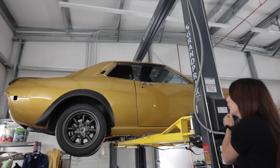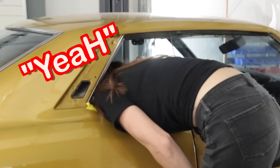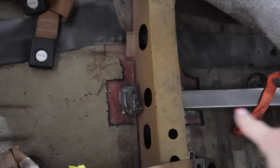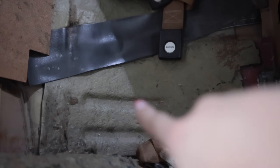Inside the car there will be a bigger plate that those four holes line up with, and it all bolts together and sandwiches the unibody portion of the car to keep those links from pulling through when the axle torques. The real question is what do I have to drill through on the inside of the car? Hopefully it's behind the back seat. There is my subframe connector right here — under the car is where it ties into the rear subframe, and you can see those indentations where that big bolt is.